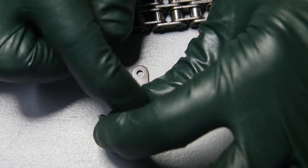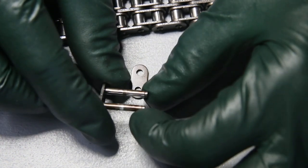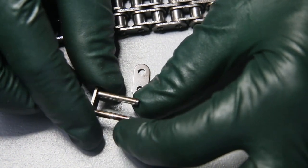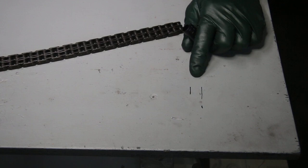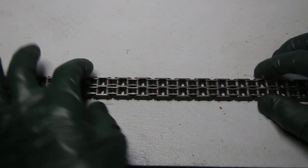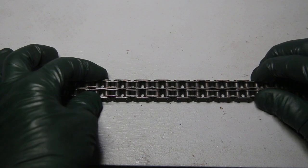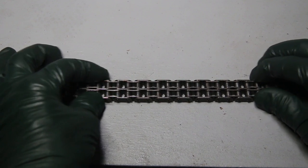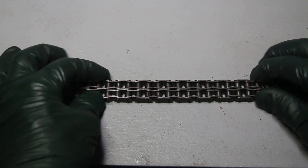Let me show you just one link I pulled out of the chain — this will give you an idea of what happens when these wear. A lot of it has to do with infrequent oil changes; it may also be the way the car is driven. But if you neglect the timing chain and let it stretch this far, you've already heard the horror stories of what happens to engines when these timing chains let loose. Take about a six-inch section of the chain right here — look at that movement: a little bit over a sixteenth, almost an eighth of an inch moving back and forth in just this short section.